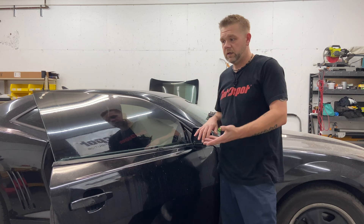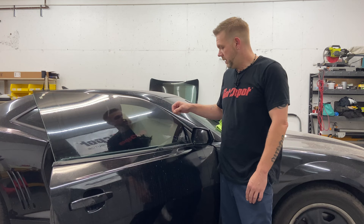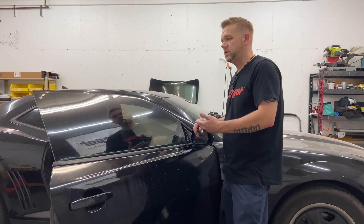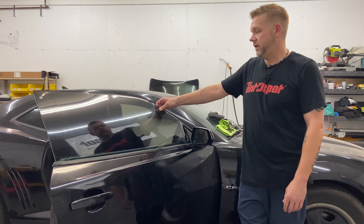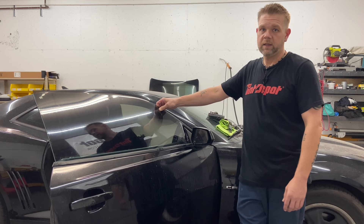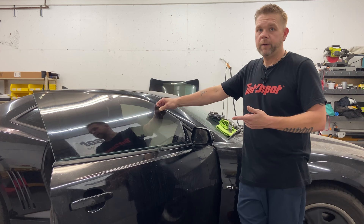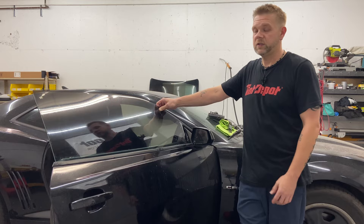That's it for this one — all the steps you need to be successful in cutting out a frameless window. The biggest things to remember: trick your doors up, line up your film, cut the bottom edge, cut the front edge, shift your film forward a little bit, cut your back, cut your top, and heat mold it to the glass. This film's ready to install. This is Tint Depot Superior Charcoal — my go-to. The other I like is their Ceramic Extreme — very aggressive, very nice looking films. They shrink fantastic and install great. Thanks for watching. TintDepot.com — all the tools and tint you'll need. Be watching for our install video on how to install the film on a frameless door. We also have a video on how to cut and install framed doors. Be sure to check them out. See you on the next one.